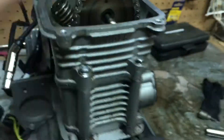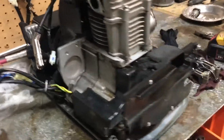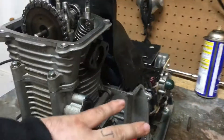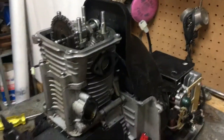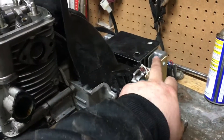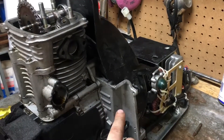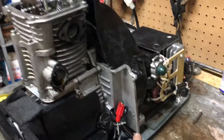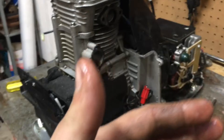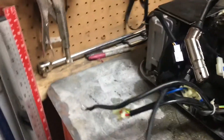Taking this thing apart is actually not so bad once you've done it a couple times. Basically what I start off with is on the fuel side: I take all the bolts holding the case halves together, then I open up that side panel, I pull off the fuel hoses from the primer bulb, the impulse line, and the main fuel from the pump to the carb, and then I take that side off with the fuel tank all together. Then you have to take the feet off first — take off all the screws, take off the feet, then you can do the fuel side.